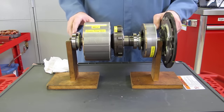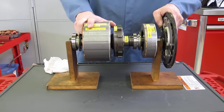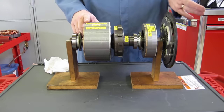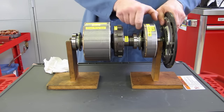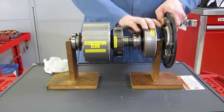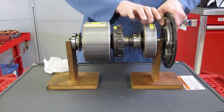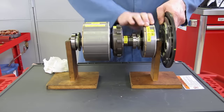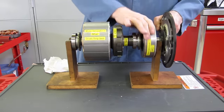If we come to a complete stop and want to back up, we can do it two ways. We can stop the engine, which holds the planet carrier from rotating, then use motor generator one as an electric motor — and notice that causes motor generator two to spin in the reverse direction, backing us up. If the engine needs to keep running, we can still get reverse, but we'd have to spin motor generator one much faster to achieve it.